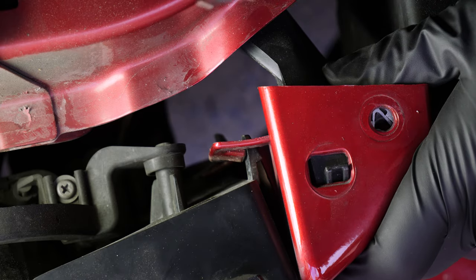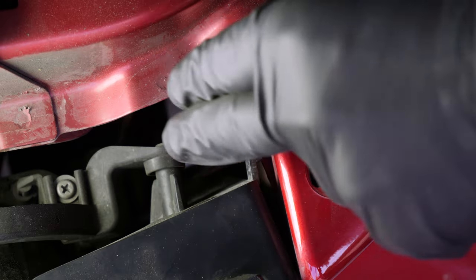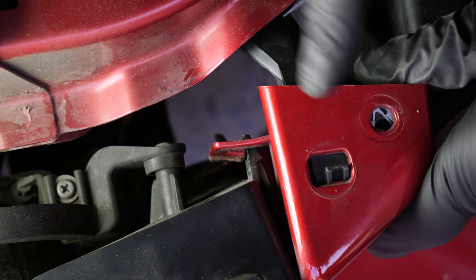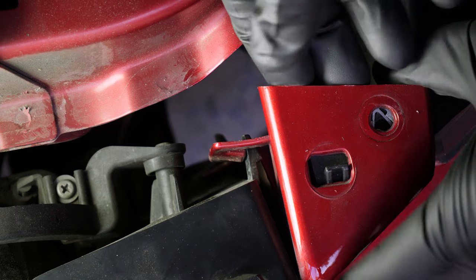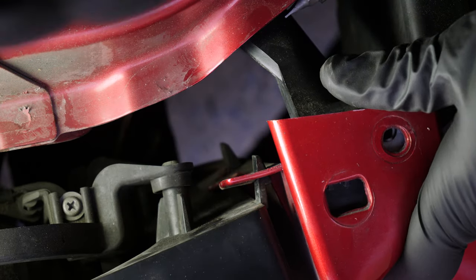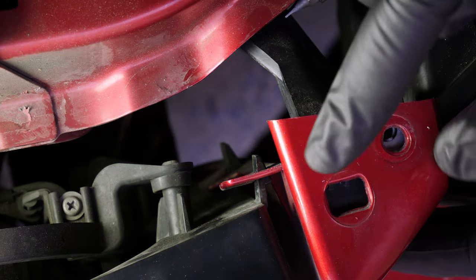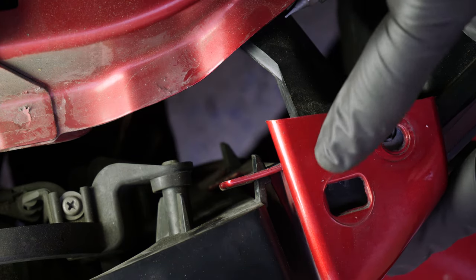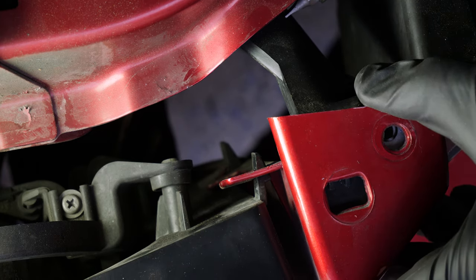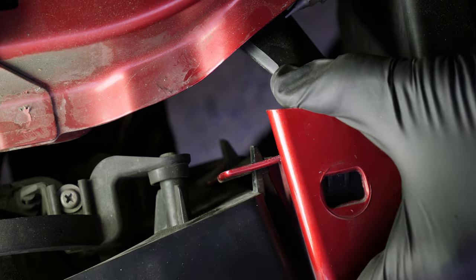The one a little bit lower, we're probably going to need a long screwdriver to push that tab back without being able to use your fingers. Also, one reason I took this screw out is that if you just lift this up, it will push out as well. The whole front of the grille will pivot, giving you a little more room to work. Just be careful because this is attached to your front bumper cover at the bottom — too much pressure may crack it or mess up your paint.